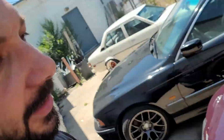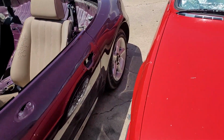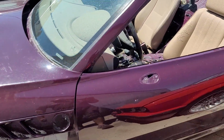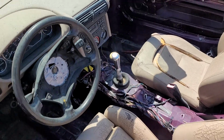But I just want to keep it 4-cylinder, keep it as light as possible, and just have a blast with it. We took it drifting that one time and realized that a 410 is not good with a manual. It needed angle, and I kept running off track and ripped the power steering cooler out of it, and then we didn't have power steering anymore, and it was pretty much not drivable. It's still currently good to go. I still need to put the power steering back in.